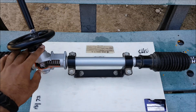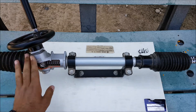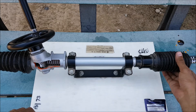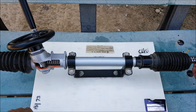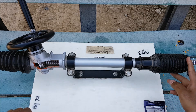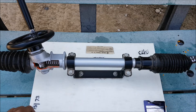We will start from its parts. Here is the steering wheel, and after the steering wheel there should be a universal joint and a steering column, but here it is a model so they are missing. After that, here is a small pinion, and this one is the rack. The main housing is here. These are the bellows or rubber boots — inside these rubber bellows there is a ball joint which will transfer the direction at any angle. The function of these bellows is to prevent water and dust from corroding the ball joints and creating friction in them.